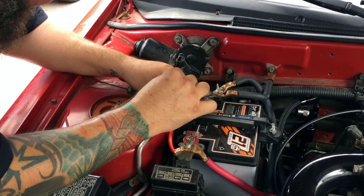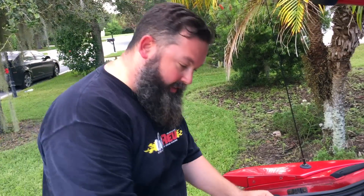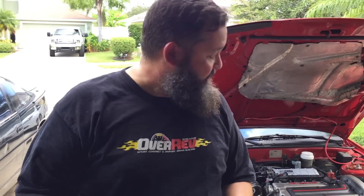That's a mighty big fuse you got there. It's a maxi fuse — it's kind of a big deal. So let's see what we got for voltage now: 13.4, almost 13.5 volts. That's a big improvement. So it's pretty easy to see that there's a big improvement in voltage there at the pump — that's more than 2 volts difference. I took a quick look at my base fuel pressure without pulling the vacuum line or anything, and my base fuel pressure at idle is up 2 psi. So I'm going to go ahead and reset my base fuel pressure back to what I wanted and call this a success.